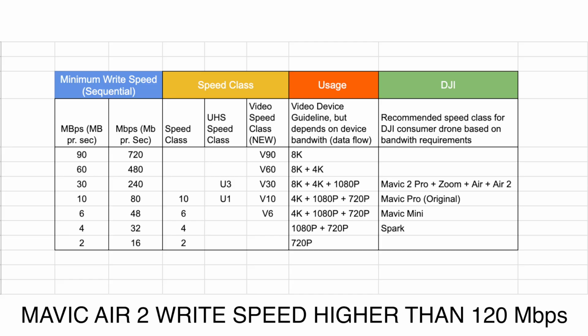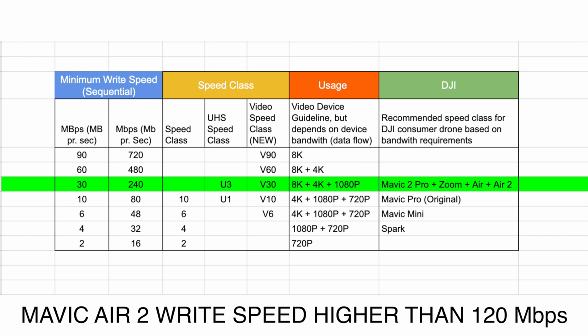And to make it easy for you, I have made this chart based on information from the SD Association and added a column with the minimum write speed, making it very easy for you to pick the right one. As you can see, you need a U3 or a V30 to be able to handle the data rates generated by the Mavic Air 2. I have, for your convenience, included in the description below some links to cards that I've been using in the past that will meet this criteria.